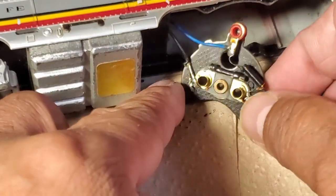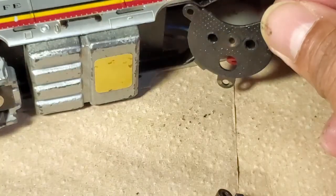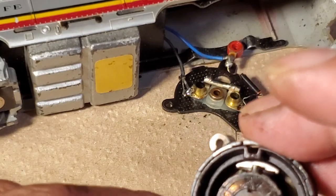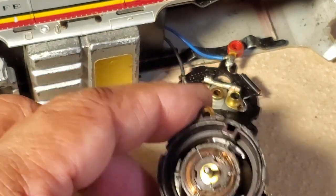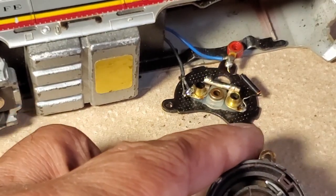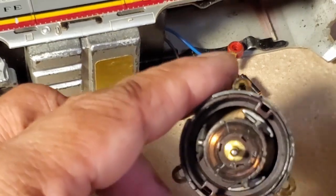Okay. Now we're going to clean the faceplate. We're going to clean the brush housings and the inside of the faceplate. Now, typically, most people would use isopropyl alcohol, but I will not advise using isopropyl alcohol for the following reasons. Most commercially available isopropyl alcohol is of a concentration of maybe 50% or 70%, or around there. But either way, it's very hard to find 99% isopropyl alcohol.